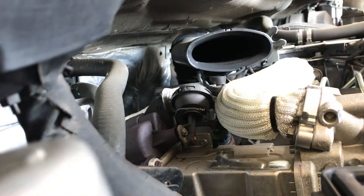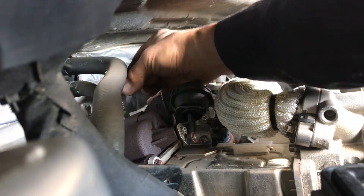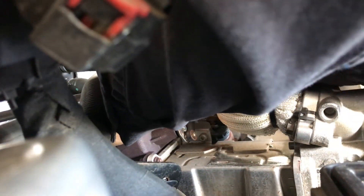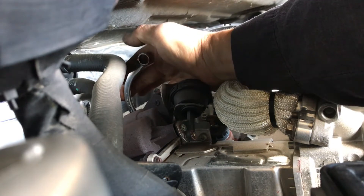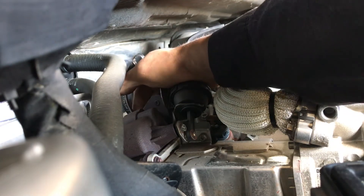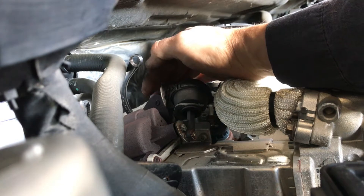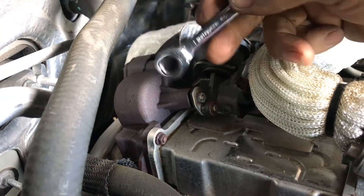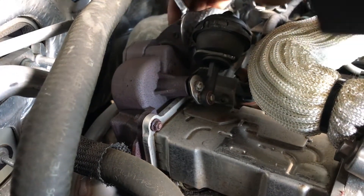Let's get to the bottom one. It's best if you can warm up the car so the exhaust is nice and hot, but then you're going to be burning your hands — it's about finding the right balance. The colder the engine gets, the colder the exhaust is, and the harder the bolts will be to remove. Once you break those bolts loose, you can use this 10mm stubby ratcheting wrench, which will be a little faster.